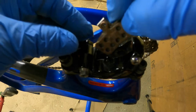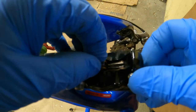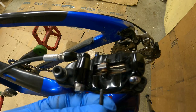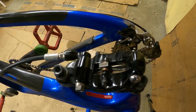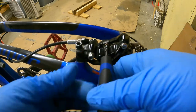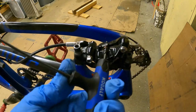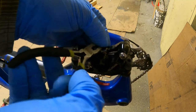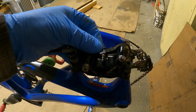Now we're back on the rear brakes. Squeeze the pads together, slide them on in. You're looking for these holes to line up for the screw to go through. Should thread in nice and easy. You don't need Loctite on this because you've got a locking washer. We'll do a quick visual check — it's on there nice.